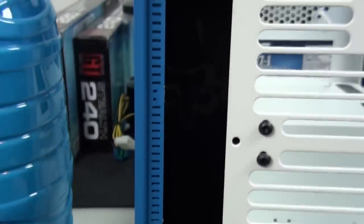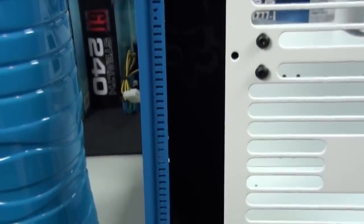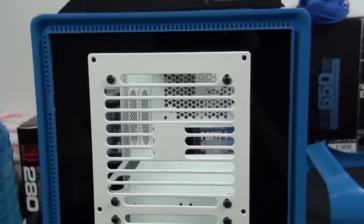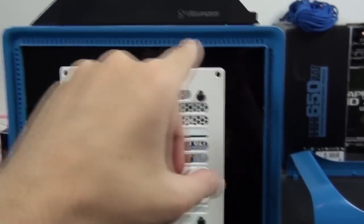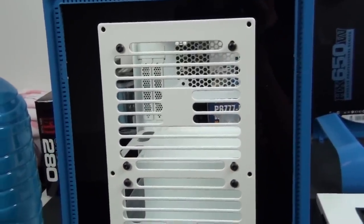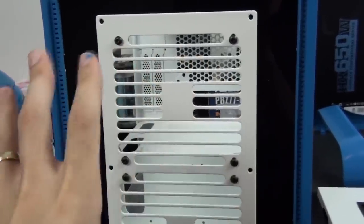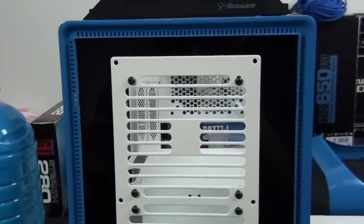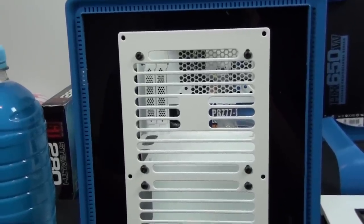The three plastic case panels that I painted blue were difficult to paint — painting plastics can always be a little tricky, but these were the BitFenix soft touch material. It required a lot of surface preparation and I used a special paint designed for plastics, but it really didn't want to take. I had to dust the coats on very lightly and ended up doing a lot of coats. It took a lot longer than I thought, but it turned out really well and I'm confident this paint job is going to last a long time, even considering this is going to be a LAN build and the case feet are going to be constantly in contact with all kinds of surfaces.